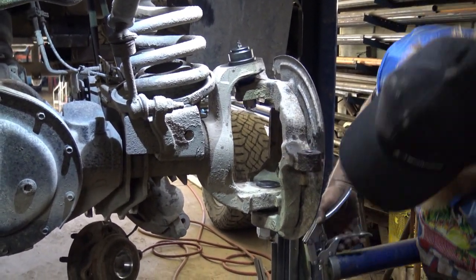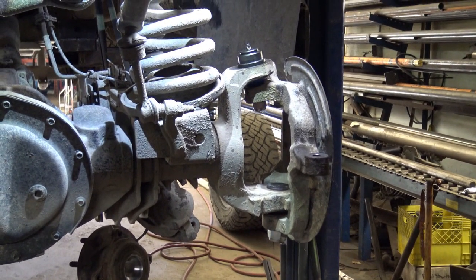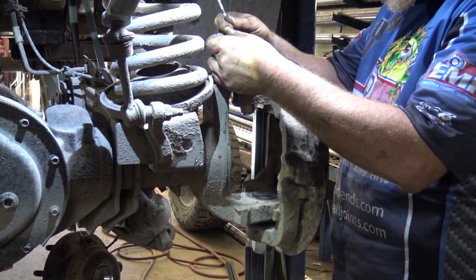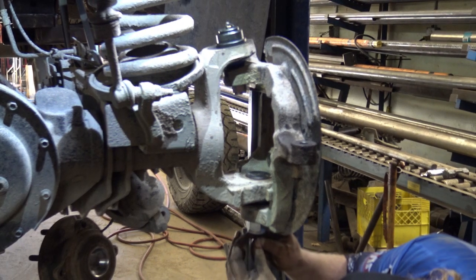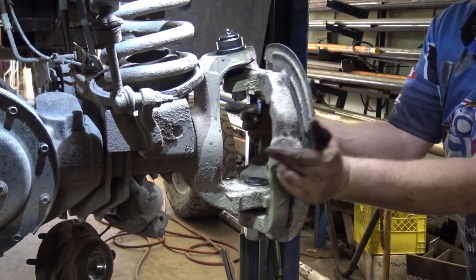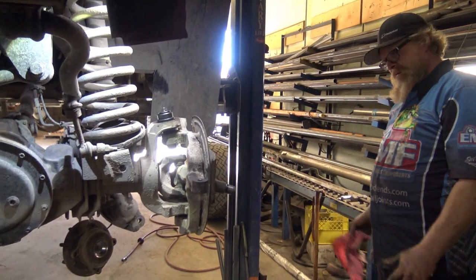So with that, you want to go down to the bottom, give it a little bit more grease. Now, if it locks up solid like this, you'll run and grab a pick, my fancy pick drawer, and relieve some of the pressure in the ball joint by letting out a little bit of grease. Then everything should move free. And the rest is just reassembly. Check your U-joints, check your brakes. Now's the time to change parts if you need to, but that's pretty much it.